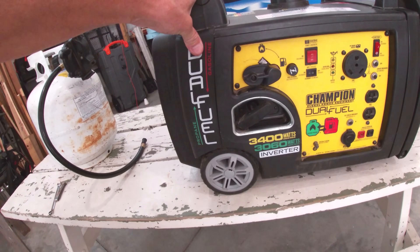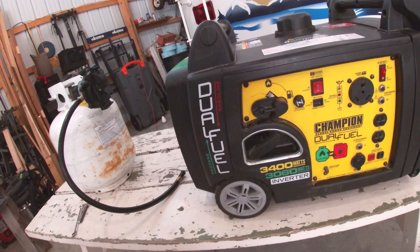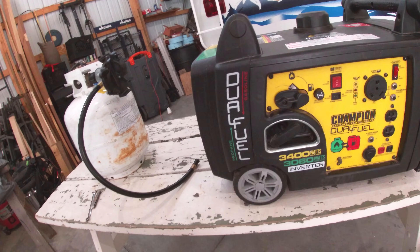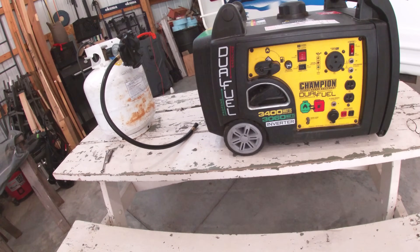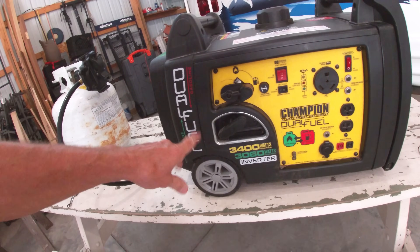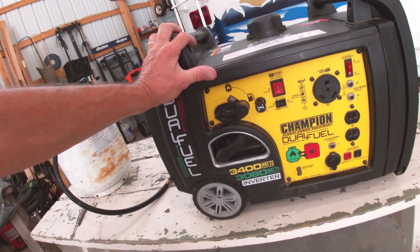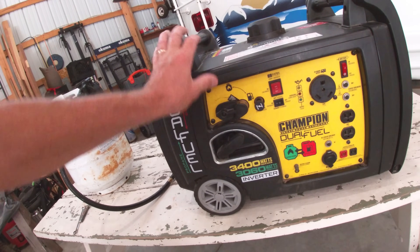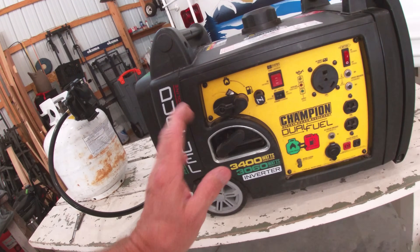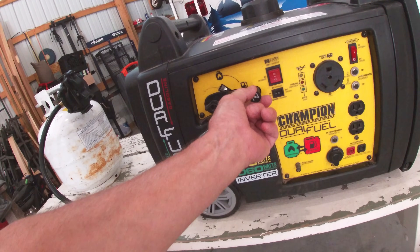I've had this thing just over three years, but this past winter my wife and I left Indiana and headed to Arizona. We went out to Quartzsite, and the plan was to do some boondocking for a couple weeks. Well, the first day out there, the generator wouldn't run correctly. The only way it would run was with the choke out. It really didn't run at maximum RPM, and as soon as I plugged the camper in, it would just kill the generator. I restarted it and kept playing with the choke in and out.